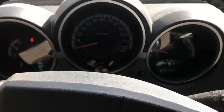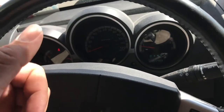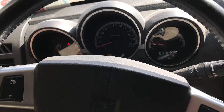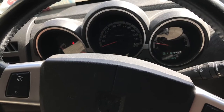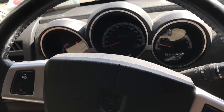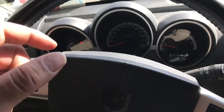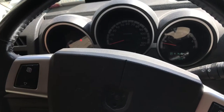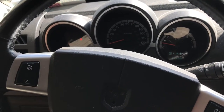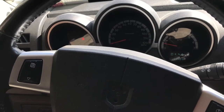When your vehicle starts going crazy, all your instrument panel here starts turning on, you definitely, let's rule out some problems that you may think that's wrong with it. It's not your battery. If your battery were to be dead, you would hear a click, click, click, click, okay? And that's just telling you that there's absolutely no power going on to your unit.